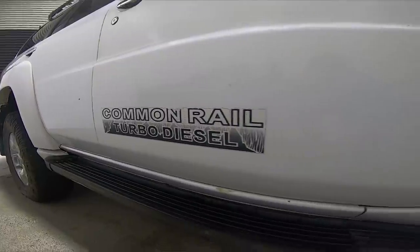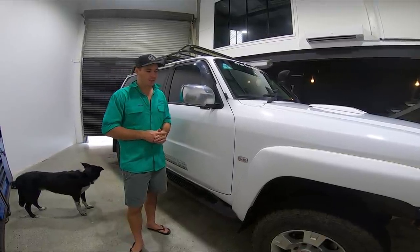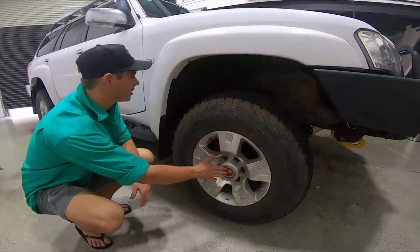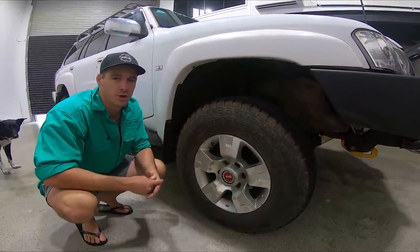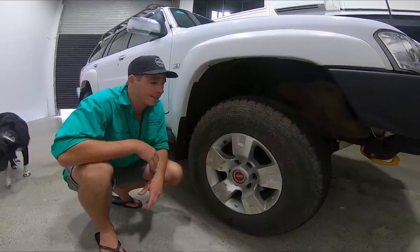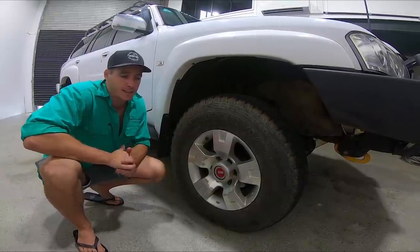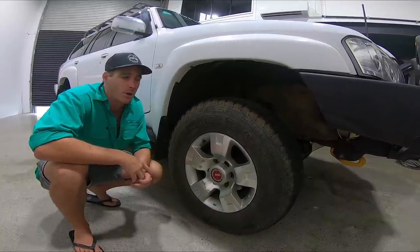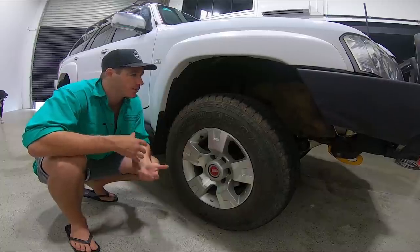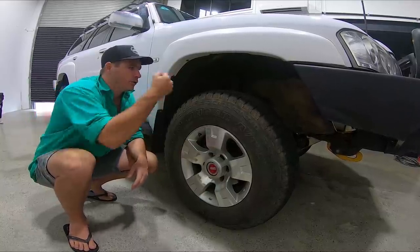It's still got the factory side steps. Suspension-wise, this thing's running just a two-inch suspension lift - it doesn't need to be anything too wild for the camera car. We've put some free-wheeling hubs on the front, and at the moment it's running Superior shocks with some Oztek on the front. We've actually got some pretty epic plans for the suspension. We've been chatting to the guys from Airbag Suspension - Jacob and Benny. I saw how extraordinary their GU Patrol went at Glasshouse Mountains running full air ride, and it's something I'd love to try. Hopefully full air ride - which is bloody cool.